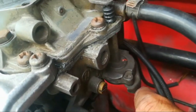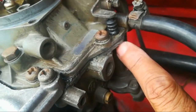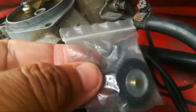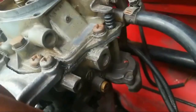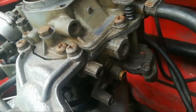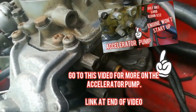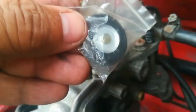Another problem on these carbs is the accelerator pump — it's the pump that pumps fuel as you put your foot on the gas pedal. It actuates and pumps fuel into the carburetor. What goes wrong is the diaphragm — a little rubber piece inserted here — develops tiny holes and then doesn't pump enough fuel into the carburetor. That gives you a problem when you need to start, which is why you'll have to prime the carb to make it start. Replacing this diaphragm in the accelerator pump will solve that problem.